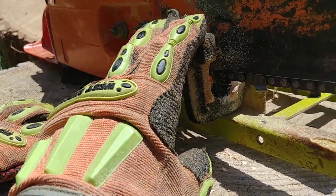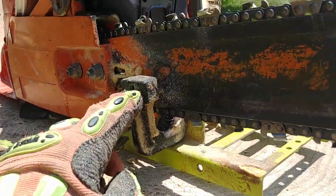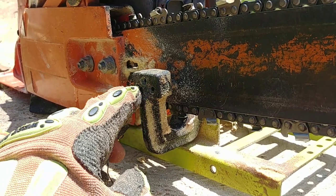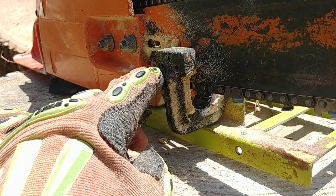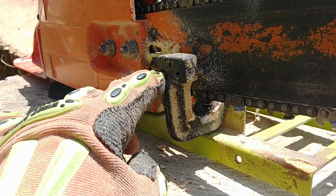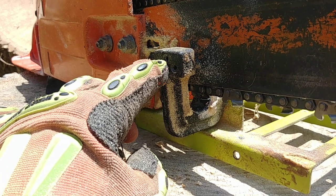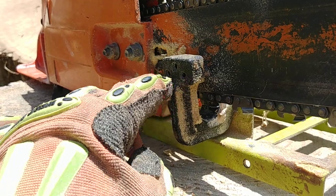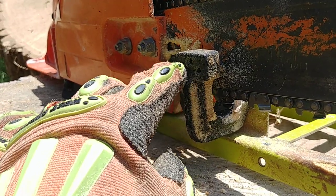So, you know, I think the old saying amongst mechanics is tight's tight, too tight's broken. So, you know, it's snug, snug, snug. You can kind of tell when they're getting tight because when you tighten this one, the other won't be loose. So as you tighten this one an eighth of a turn, when you get to this one, it'll kind of be loose. And then when you get to this one, it'll kind of be loose. And you'll tell when it gets tight when they're not really getting loose.